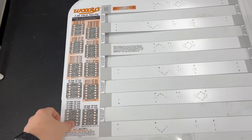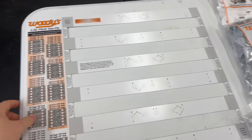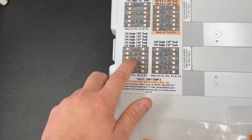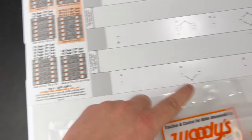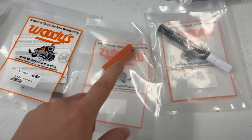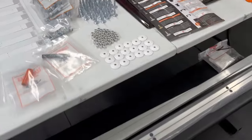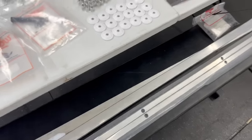Woody's also has stud templates — this is a 2.86-pitch template, two-ply, because both of these Polaris tracks are two-ply and these sleds happen to be 2.86 pitch. If you have an XCR it's a 2.52 pitch. I'm doing all singles, three per row, which comes out to 153 singles on a 146-inch track. You mark all the O's, B's, and X's using the marking pen, then use the track driller and stud holder for the backside.